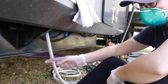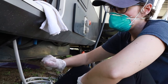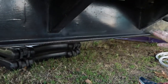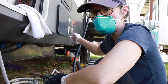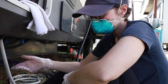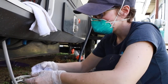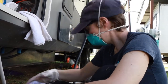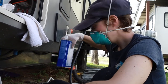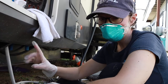We did the other side, and this side we have washed with a wet rag and then sanded spots that looked rusty. This actually is pretty good — it was mostly behind the tires where there's a lot of water during travel. Now I'm getting rid of the dirt and the residue left over from sanding using my little blue can of denatured alcohol, and then it's all set for Garrett to spray paint.